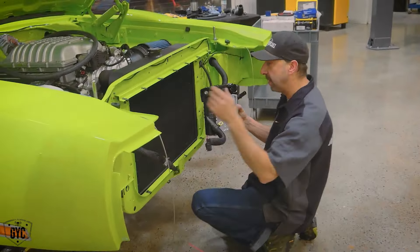Right now I'm going to put this bracket on here. On my Superbird nose, we're actually using an actuator to run the headlights, so I got this motor unit that's going to be sitting right in here. I had to do a lot of measuring to make sure I had room. What I came up with is using their factory bracket with the rubber insulators to mount this, and the top plate of my nose comes up here. When these screws come through, I've got to allow clearance — I can't just bolt this right to this plate — so I'm going to step this down a little bit so I'll have clearance for my screws when the top piece comes on, but still be able to reach all my hoses.